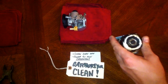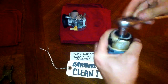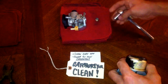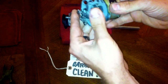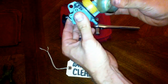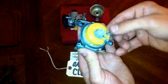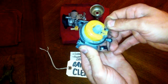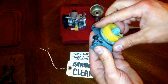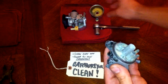First I'm going to go through the Briggs & Stratton. Get your half-inch socket and pop the bolt off the bottom. Take the bowl out — when you pull it off you're going to need something to catch all the gasoline that's coming out. You're going to have a pin right here attaching the float; pull the pin out. You'll probably need needle nose pliers for that. There's your needle and then your float — we're going to keep those in the bowl right there.